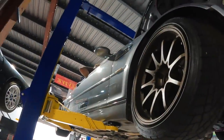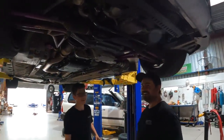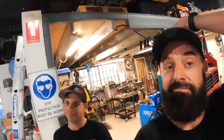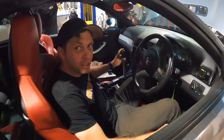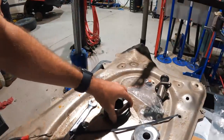First test — it's too stiff. We've got some adjustment in it, so we dial it back. How does it feel, Dan? It feels good — like an S15, that nice little aftermarket clutch feel. After adjusting, it's not squeaking anymore and Dan says it feels fine, feels like a clutch. Phase one complete! However, the Belleville springs were just too stiff overall — it felt like an old-school heavy cable clutch, which isn't what we want. We've gone to two valve springs with a certain amount of preload, and Dan's happy with that.